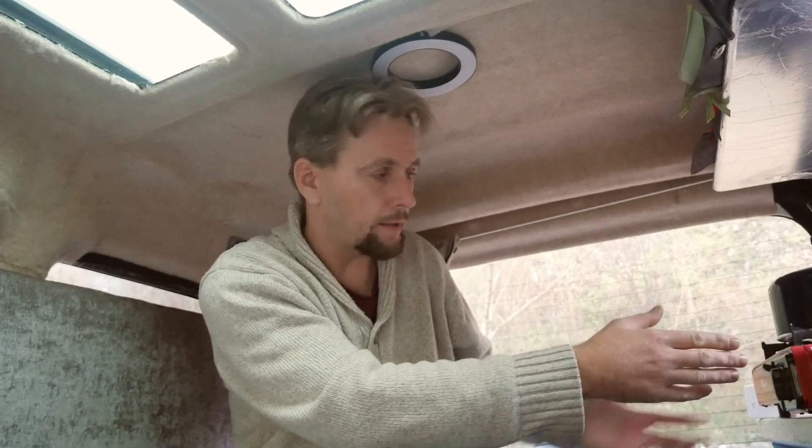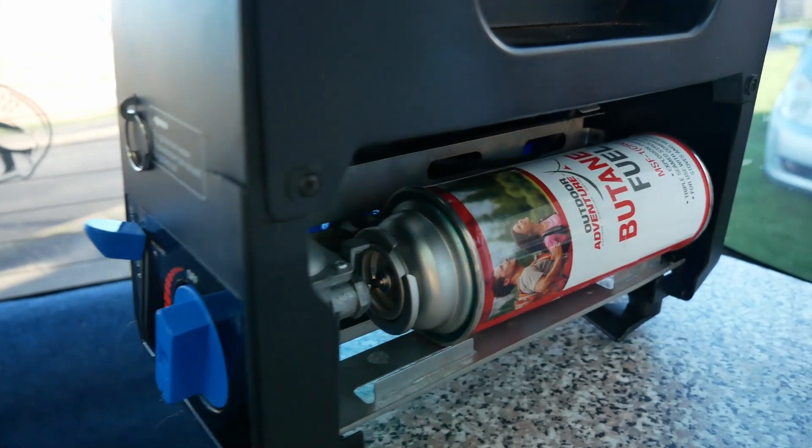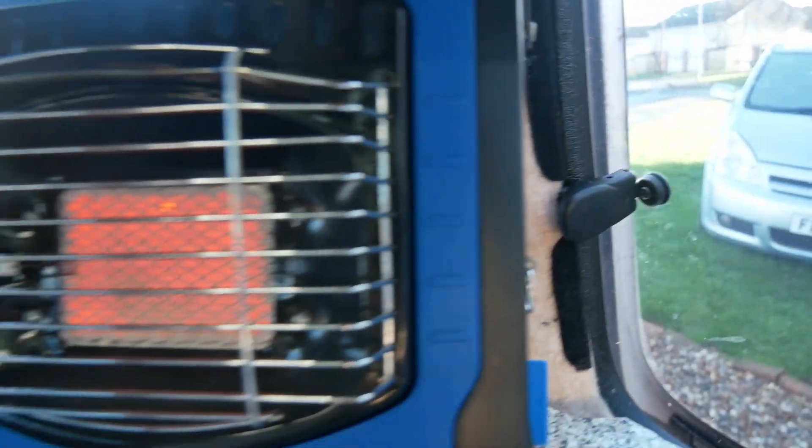If you need that little bit of extra heat and your van is pretty well insulated, I've got one of the little gas butane cookers here. It's mainly for doing a drink, but have your window open a little bit to let air in because of carbon monoxide — make sure you've got detectors. Just having it on while making a cup of tea or coffee, there's enough heat that comes off it in this small space to take the chill off. I also have a butane heater that takes the same bottles as the cooker. Same safety applies — open a window. It's just a backup and I don't really use it that much.